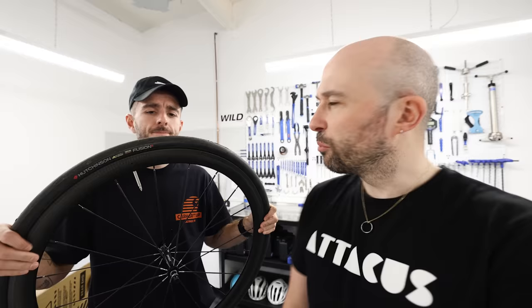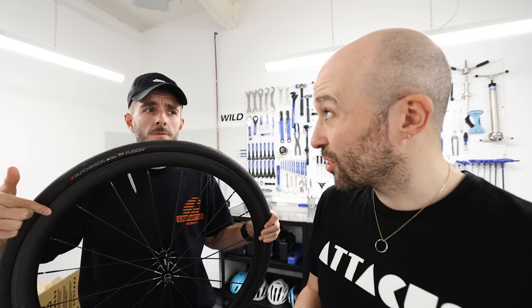You can start to feel that jump-jump-jump sound as it jerks — that's the time to stop riding, get off the bike, cool it down, and let it try to recover. As I said, carbon doesn't stretch, so if the wheel rim is still hot that carbon will want to go back to where it was. It will still try to return if it's still malleable enough, so if you can stop while it's getting hot, deflate the tire, you can save your life. We've both ridden loads of carbon braking surfaces and personally I've never had any issues, apart from when they're wet and they don't stop.